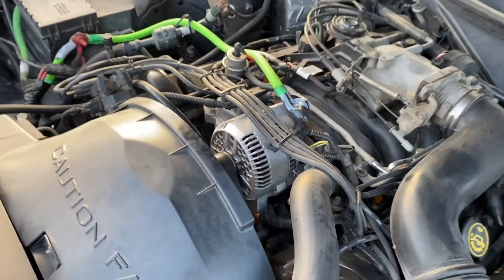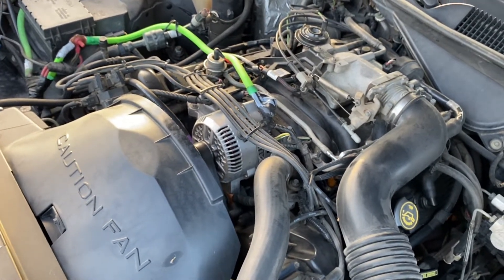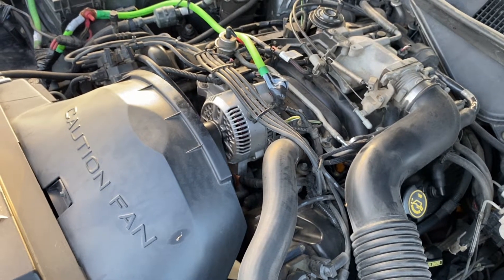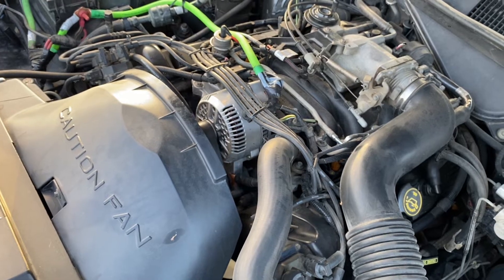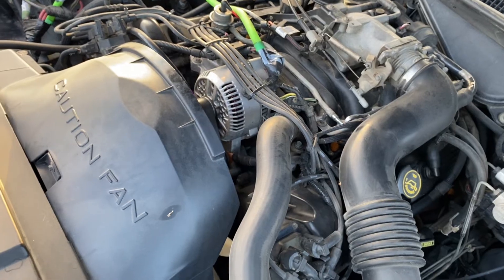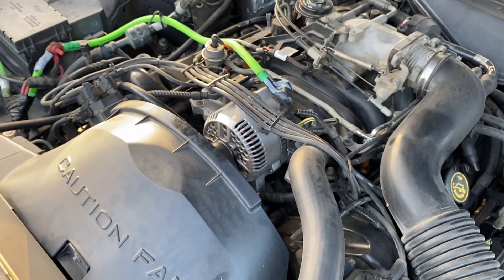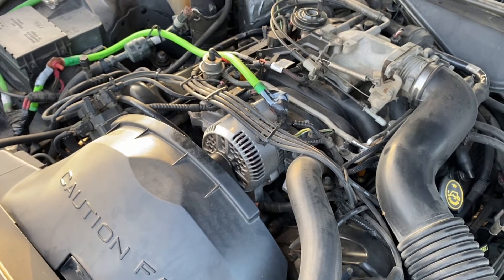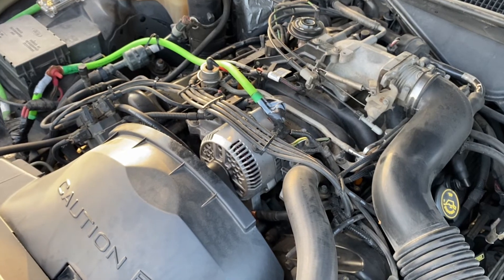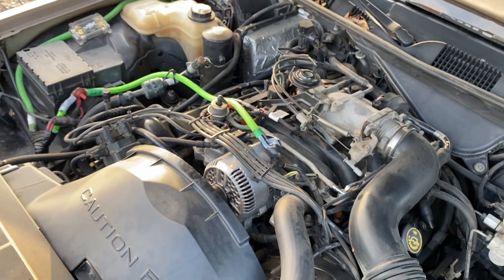Like I said, if you've got an AGM battery don't leave it in there — or at least pay attention to your voltage. You really don't want it to ever run over 15 volts. Anyway, I just wanted to show y'all that real quick. I'll hit y'all with another video in a couple days — we've got a car meet this weekend and I'm going to be doing some in-depth reviews on some vehicles, so check that out. Bass heads, peace.